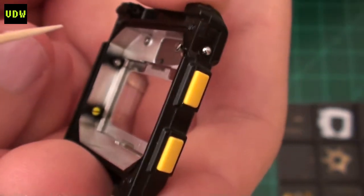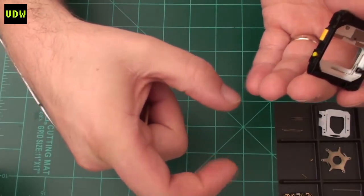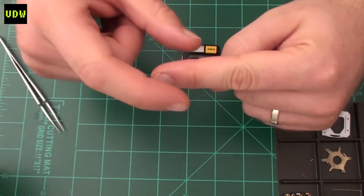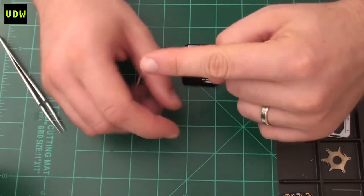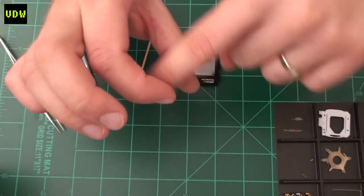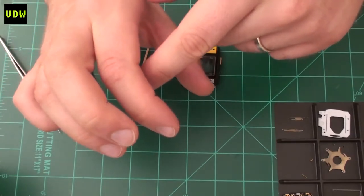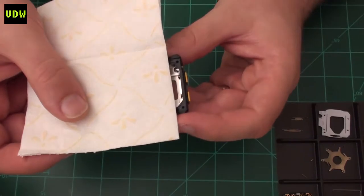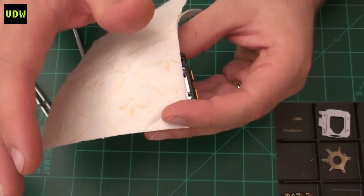This is a harder plastic so it might take alcohol better, but it still damages it. Use mild soap or a special cleaner and rinse it very well. Taking off the buttons from a digital watch — in 99% of cases they have special washers around them. The button has a channel dug around its perimeter in which the retainer washer sits, and another channel in which the gasket sits. To take out a button you first have to push out those washer retainers. They are interrupted at one point and you can use a screwdriver to push it backwards — I recommend doing this carefully and under a microscope.